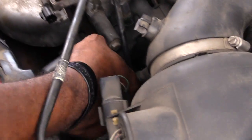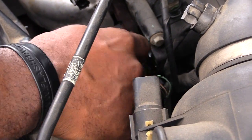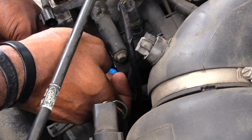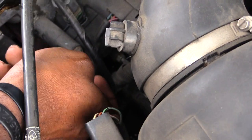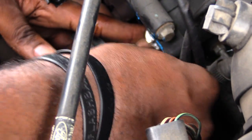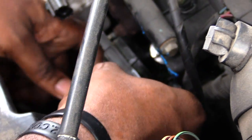First I'm gonna look at the housing, get some sealant and kind of wipe it on here — I want to make sure it's clean, it just helps make a little seal around it. Get it around there. Next thing I want to do is get my new thermostat. I'm gonna take it and just stick the thermostat in — you want to pull the housing back and make sure it's secure all the way back up in it like that.